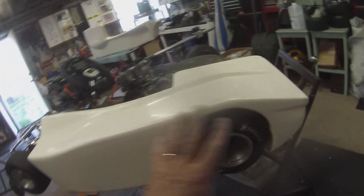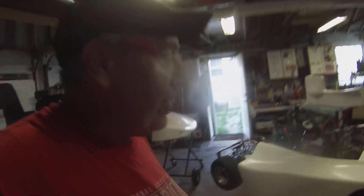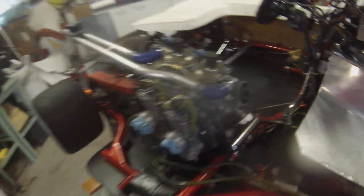These wheel openings are in stone. So if we got the nose in the wrong spot and these didn't fit right, we'd have to remount the nose. We only want to cut things once. What I did is I put two pieces of this little three-quarter inch — I think they're old bed slats — they go all the way out each side, under the stand and under the chassis, simulating the bottom of the chassis from side to side. So the pods will sit there and won't be too low in the front. They give you a little extra room here, probably for tire growth.